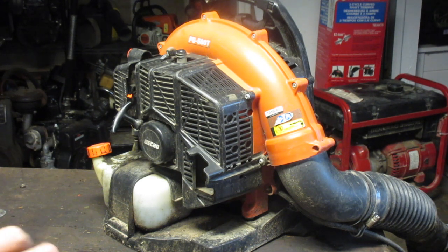If you're having issues, check to see if your carburetor is fully seated. This is a textbook definition of a vacuum leak. Vacuum leaks on idle, you probably could get it running. It's going to be a real dog to start, though. But, yeah, this should be about it. Well, this is simple, kind of stupid, but it worked.